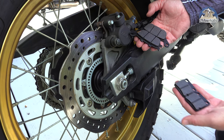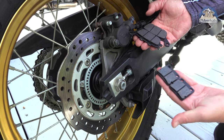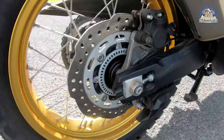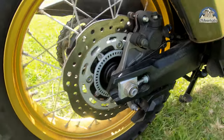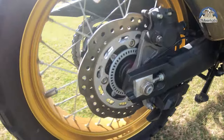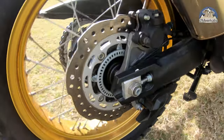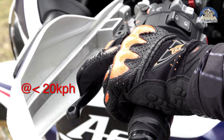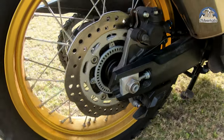These are the rear foot brake pads. These are the rear hand brake pads. And as you can see, there's quite a difference in the size. Originally I thought my Two Meerkats hand operated brake mod would wear away the smaller cable pads of the second caliper, so I kept a spare set of pads handy. In fact, they lasted for ages with low wear, as I only used the brake with one finger pressure below 20 kmh in technical situations.